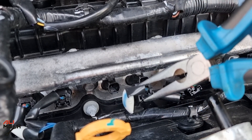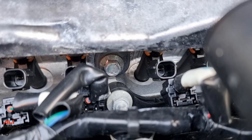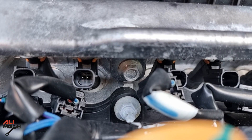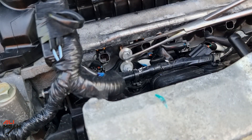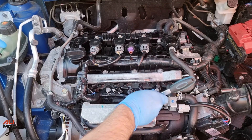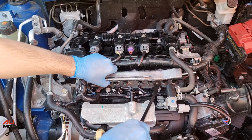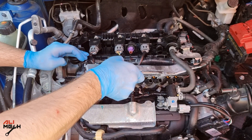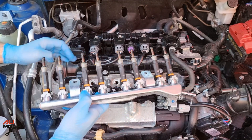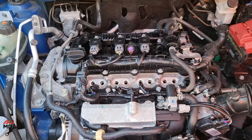This engine has eight fuel injectors, so make sure to remove all eight connectors. Needle pliers work best for pulling the connectors in this tight spot. Next we will remove the two 10mm bolts of the fuel rail. You'll need a ratchet extender and 10mm socket — a small ratchet set works best on this spot. I'll use a plastic clip removing tool to pull the fuel rail out, but you can use a long flat screwdriver as well. And here are all eight injectors.